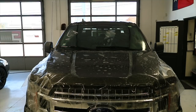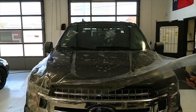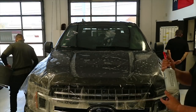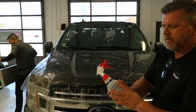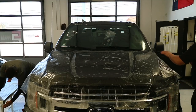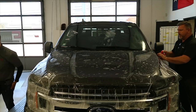I'll shoot a little more slip underneath here to get it nice and wet and slippery. I actually have a water dispenser over here and I mix it with warm water — this is actually warm — and it makes it tack a lot quicker. The first thing I do is get the film positioned back here, and I'm not tacking it on the hood — I'm tacking it on the fender.